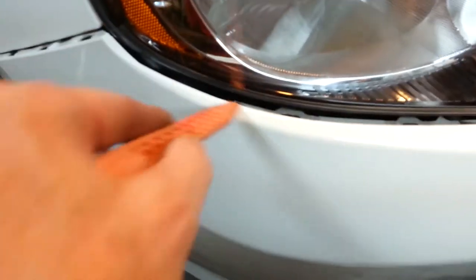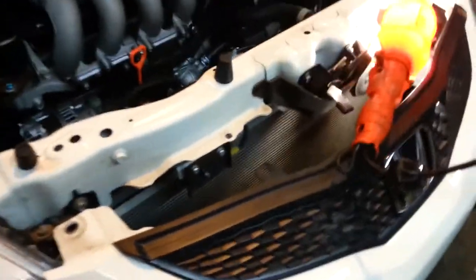I was going to show: when you go to get this thing apart, it's kind of tricky. You think it's going to start breaking all the plastic. There's a Phillips screw kind of hidden up in here you want to be sure to get that one loose, and there are all kinds of plastic snaps all over the place on the bottom. I got this thing up on jack stands to get a little more clearance with the wheels off the ground. You can see where I used the plastic tool to help unclip these pieces under the light - that really made a difference. I just started here, walked around, and popped each one individually until it came off.